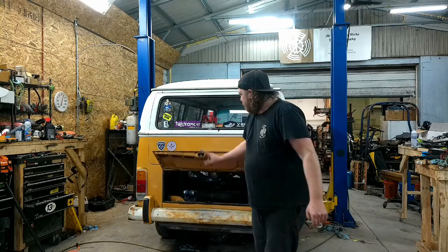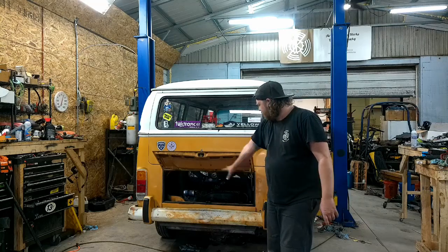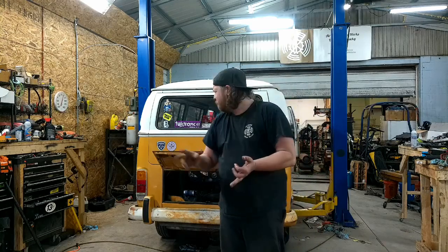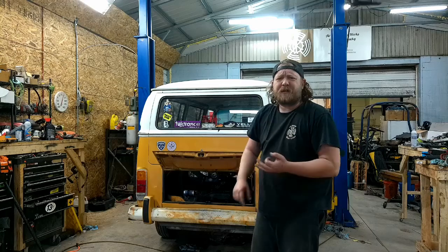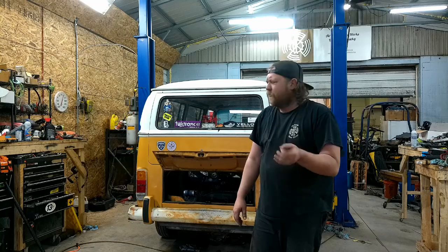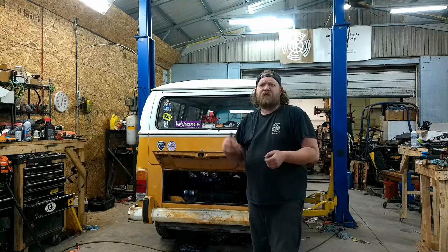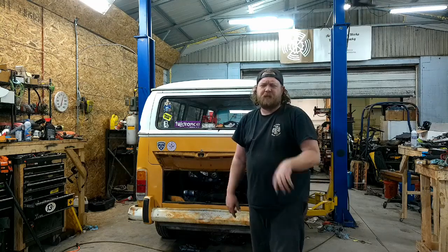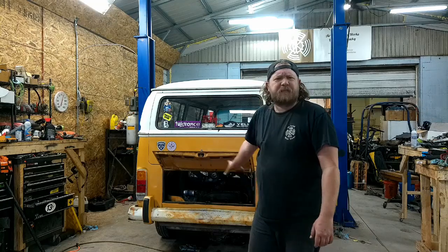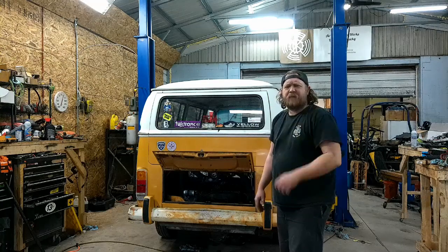But anyway, this episode we're going to get into the old power horse barn back here. Something simple: check valves, change oil, look it over, new plugs and an electronic ignition. Maybe dial in the carb a little bit because it does run well, but the owner told me that when it gets hot, it likes the diesel. So I guess you cut the key off and it'll still run. So with that said, hoping it's just something simple out of adjustment and we'll just throw the simple parts at it, take it from there.